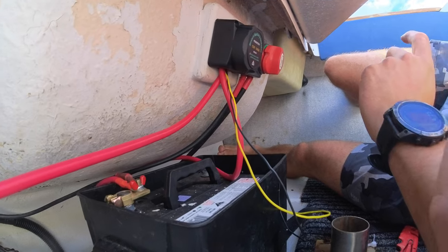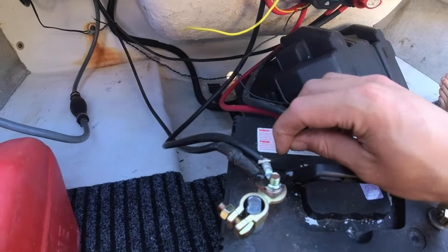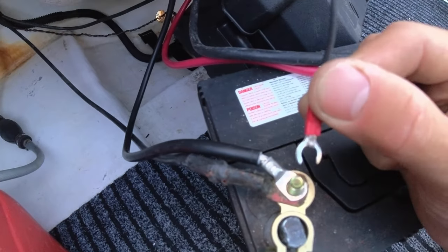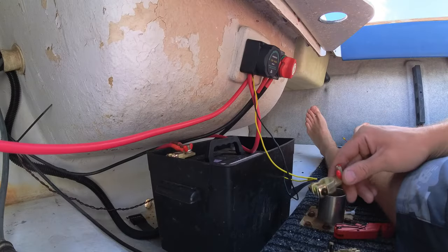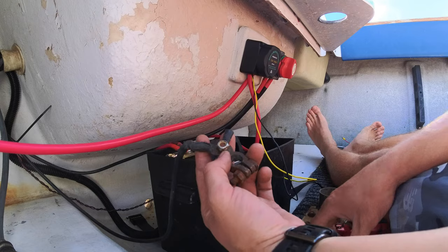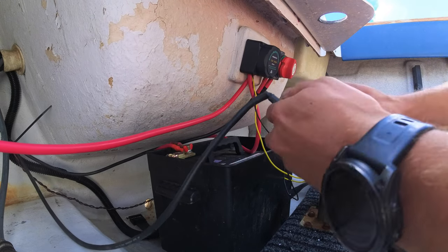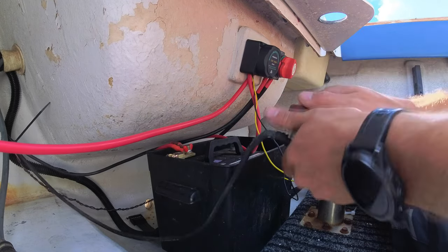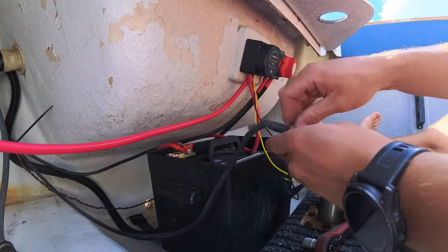Right, those two are fitted nicely. The black cable is your earth; the yellow one will go to a switch — I might put a switch on the dashboard and run that cable up out of the way. That's that pretty much done. Now for the auxiliary battery negatives: the black cable coming from the smart battery isolator has to be connected in with the negative on the battery or it doesn't cut in and out. I figured that out at the end. I've crimped that one on and slid it in. As you can see, one's nice and new and the other is disgusting — so I'm swapping out the old one.